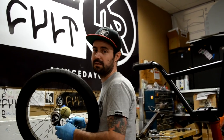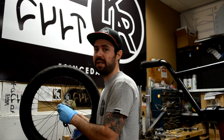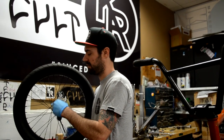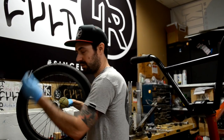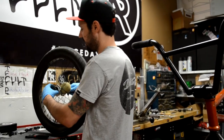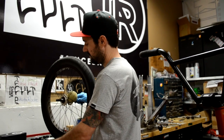You are going to want to break this loose, and we'll see if I can handle this. So once you break it loose and your knuckles survive, you unthread it — which might take a minute. Don't forget, you set it off to the side. There is a washer on the inside — you set that to the side. The driver: to take it out you just twist and pull on it like you are unscrewing it and it slides out. That simple.